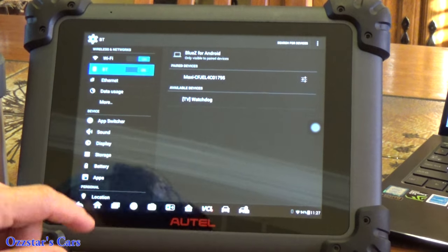We have code Z03041: Energy Management Active. Interesting — maybe the battery died and the owner jump-started the car, which is probably why he wants a new battery. It's about nine years old and appears to be the original battery. This is freeze-frame data showing when the issue happened. The voltage was only 11.5 volts — that's pretty low, that's pretty bad. The car has 80,909 miles on it. It happened on November 19th, a couple days ago.